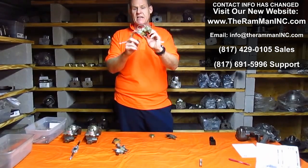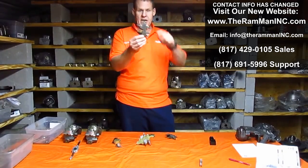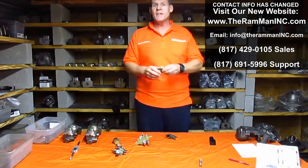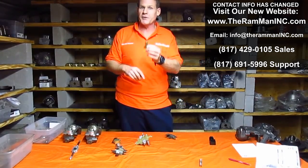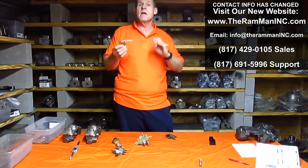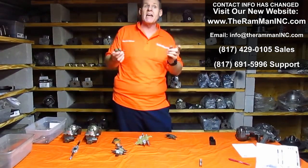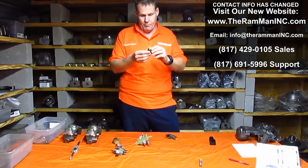Here's one standalone. Here it is on the back end of this combination T-8 valve. Here it is on an A-body valve — right here, that's part of it. They were all designed with a cut-in pressure or spring pressure depending on the model — A-body, B-body, and such. Normally 250, 275, and on station wagons about 300 was the cut-in pressure.